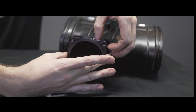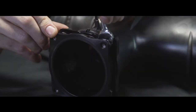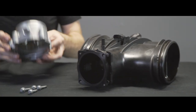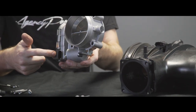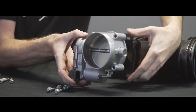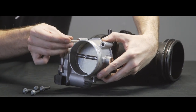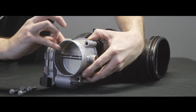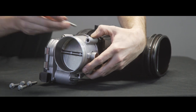After that, you really just have to tighten down the M6 screws and the adapter will be put into place. Once those are nice and secure, we'd actually go ahead and install the upgraded throttle body. Keep in mind the orientation of this clip wants to be in that lower left-hand corner. Line those up. Use the supplied hardware — M6 by 1 stainless steel screws. Just get them finger tight for right now.